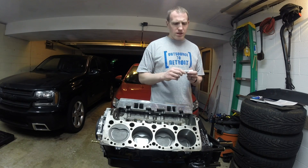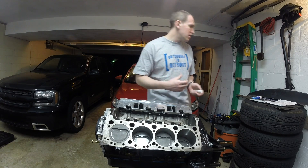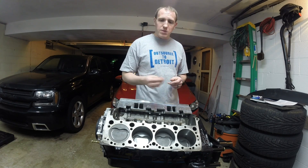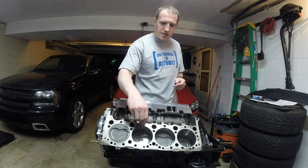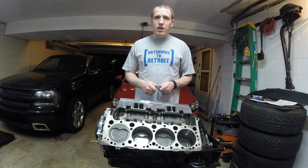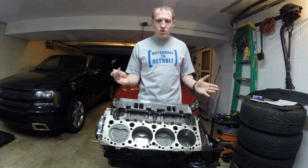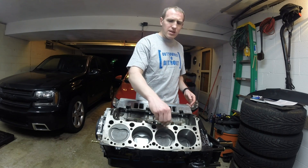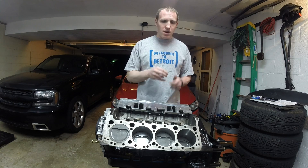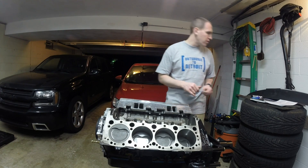It's actually almost like hand cream the way it goes on there, but you just have to make sure not to mix it with the moly lube on the heads of the bolts. The other thing I've been doing is chasing the threads — it's not a tap, it's a chase. You spin this in, just sort of cleans them out. This block is flawless. Golan did a nice job with it. The threads are fine, so this is kind of unnecessary, but it was a little $15 tool that came with a bunch of sizes.